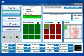Here you see that the grayed region has changed, because when we made the auto calibration we see that the idle point is this. Due to the fact that the auto calibration got a good calibration and good mixture for idle, we can avoid adapting here because it's not needed.